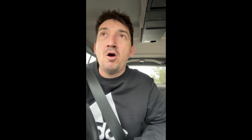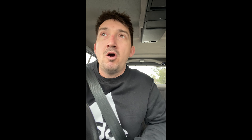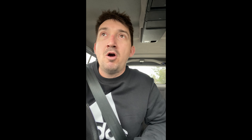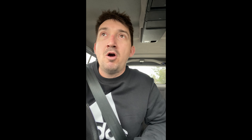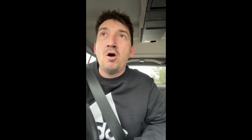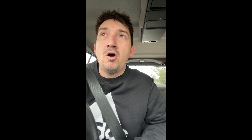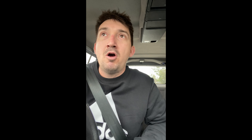I've just been talking to my mate Chris — he reckons I should go full standalone, and he might be right. This might be the AC plug, not the dash, and that there is the dash plug. That plugs into the JZ ECU — I'll have a look tomorrow and see if it plugs straight in. And over here, that also plugs into the JZ ECU. Those are the ECU plugs for a JZX ECU — JZX90 and JZZ30 sort.